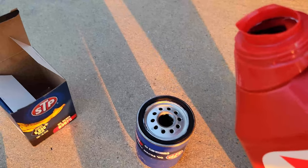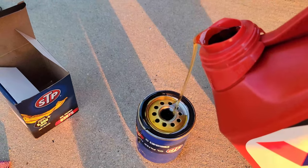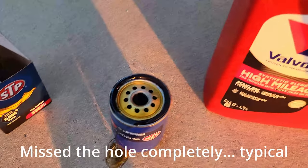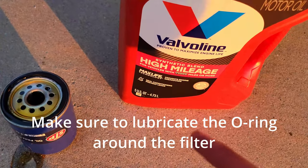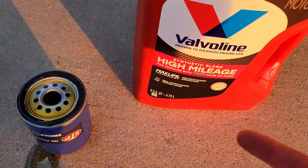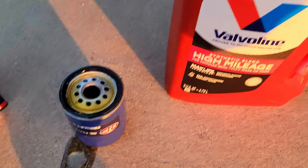I'm going to pour a little bit of oil into the filter to get it sort of prepared for its job. Made a huge mess, that's fine. You only need 5 quarts for this big 472 — I've got a 1.8 liter Toyota MR2 Spyder that takes 4.5 quarts, and this 7.7 liter V8 takes 5 quarts. Kind of interesting.